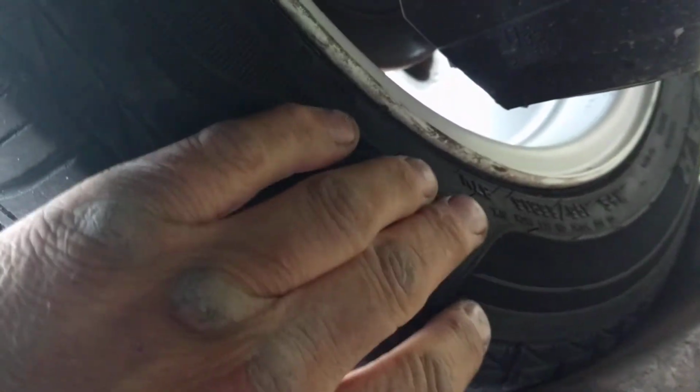The whole sidewall of the tire is compromised and it is ripping off of the carcass of the tire. It's actually a very dangerous situation, and I'm glad I pulled the tires off of this thing before I really drove it, because that would have caused a lot of damage to the car and potentially to me. I don't know why there's a piece of plastic hanging from there, but I guess I'll take care of that. And here is our gas tank, intersected by the exhaust pipe. Yeah, maybe it's not stainless. I don't know. But anyway, that's been the tour underneath the Mini Cooper.